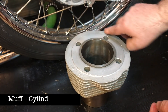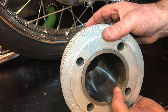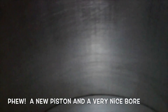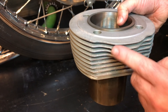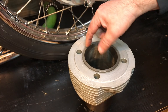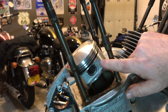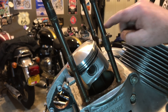Starting with the barrel — or the 'muff', as it's called in Vincent language — and looking at the liner inside, you can see it's in really nice condition. We saw that a little bit with the bore scope when we put it in through the spark plug hole, but it just looks magic. They may even be new — I'm not sure. These are relatively inexpensive actually. I'm curious as to why the pistons are 40 over if there was going to be a rebore, because normally you'd just go back to a standard size liner with a standard size piston.